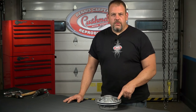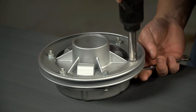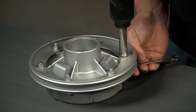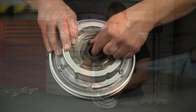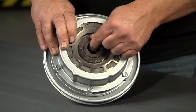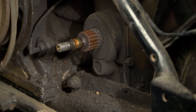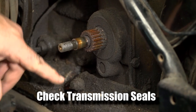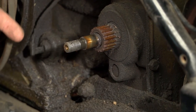Next step is to tighten all the bolts and check for clearance. Now that we've got all the bolts tight, we need to check our clearance between the inner plate and the outer plate, and it should measure between 1/32 and 3/32 inches. Now that I've checked my clearance and everything checks out, I'm ready to reinstall it on the scooter. If there's excessive oil on your clutch, you need to check your transmission seals. On our scooter, you can see it's been leaking really bad. Oil leaking into the clutch will cause the clutch to slip or the plates to swell, so that has to be remedied first.